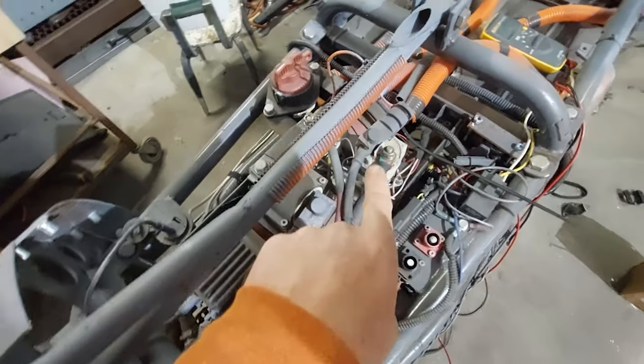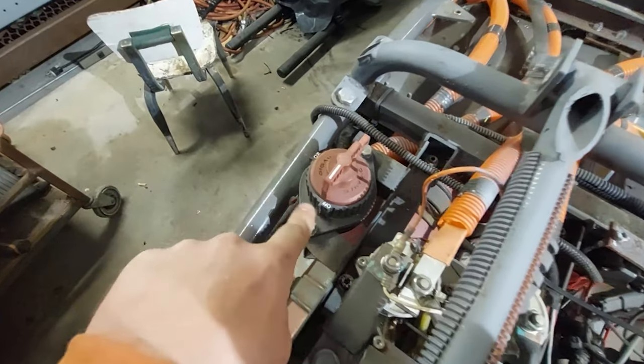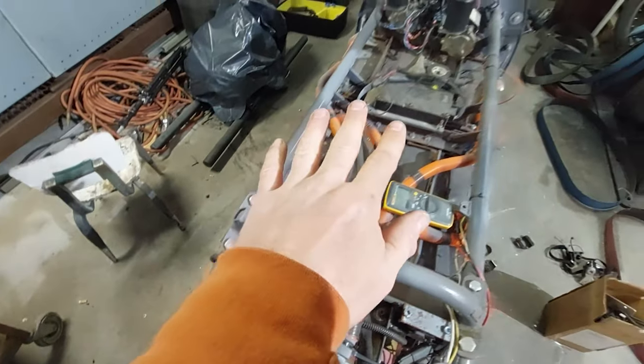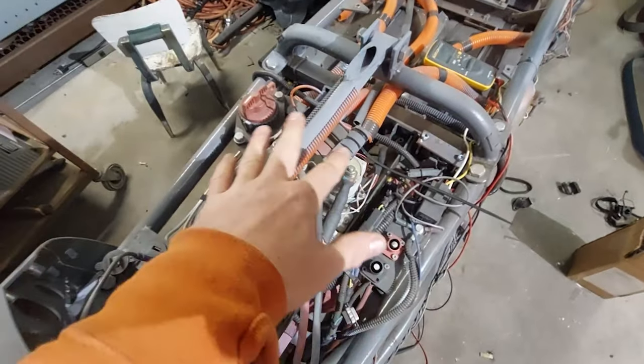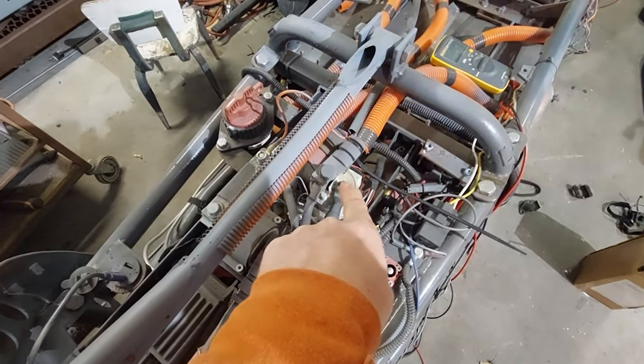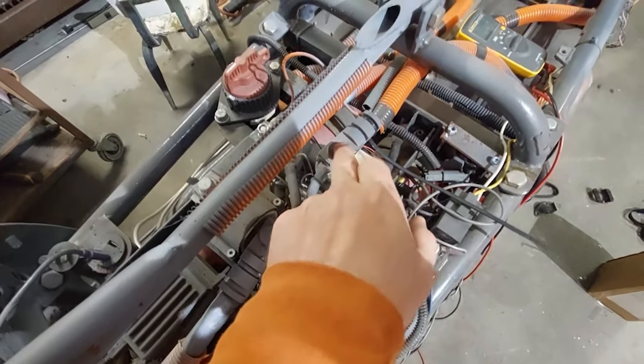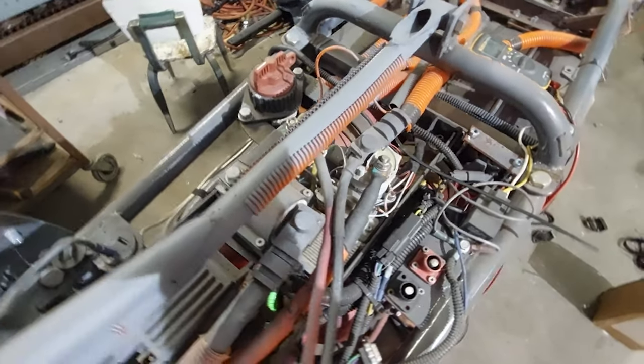No ring. Okay, so this is my negative contactor. Right now, we have broken the voltage. See how it's on the off? We've broken the voltage from the pack halfway, and we do not have live voltage across here. But if you touch this, you're still at half pack voltage. So 170, not the best idea. So I'm not going to be touching this right now. I'm actually going to install some new covers after I do this install.